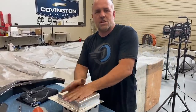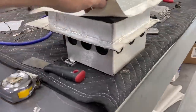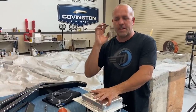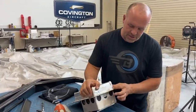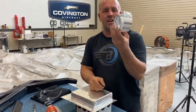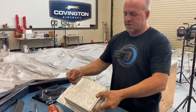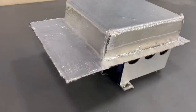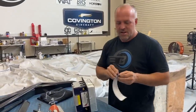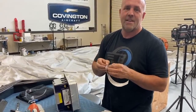Getting the fire shield backing on my little battery box — it's a peel-and-stick product, about an eighth inch thick, really amazing. Sometimes if there's ever a chance you might get oil splashing on it, the edges or seams where they overlap will start to lift over time, and that drives me nuts. So this simple high-temp foil tape for HVAC works really well to just tape over any of the seams. The oil can't get down underneath those fibers and start to lift an edge. It's just an extra couple minutes, weighs almost nothing, and saves you grief later. Last step — put it in the plane.